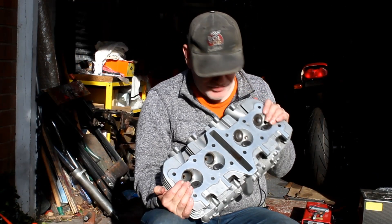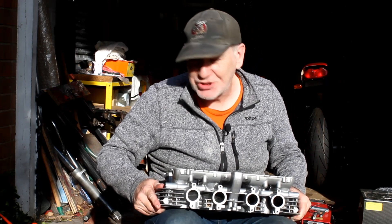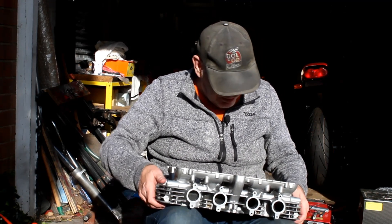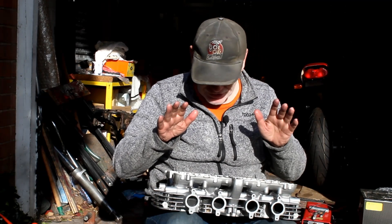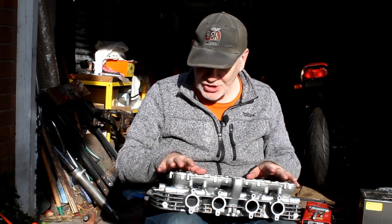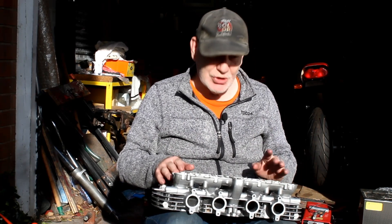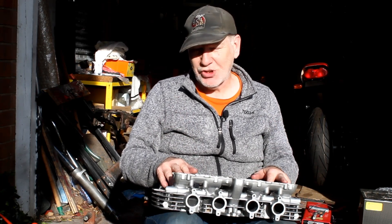And so there are all six of the valves that I can fit now fitted, which is fine. I'm probably going to end up destroying those two new valve seals that are fitted incorrectly, but I've just checked online and I can buy them individually, so it's not such a big hit to the pocket. Anyway, that's it for now. In part two of this engine build we will finish off the work on the cylinder head — I won't fit the cams yet because they have to come out anyway when I fit the head to the complete engine to fit the cam chain. So in part two we'll finish off the cylinder head and make a start on the bottom end. Thanks for watching and cheers.